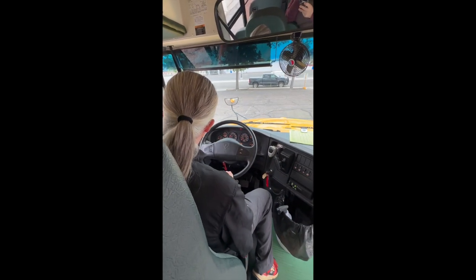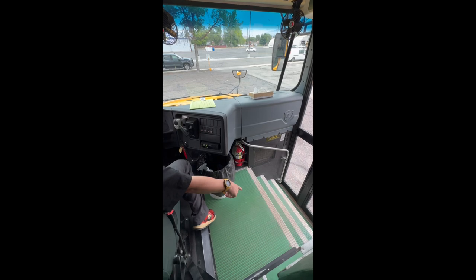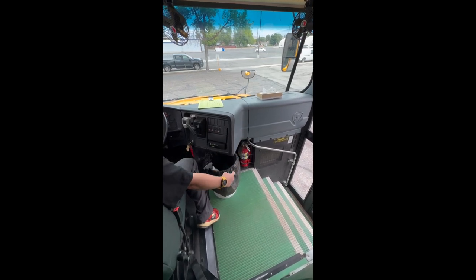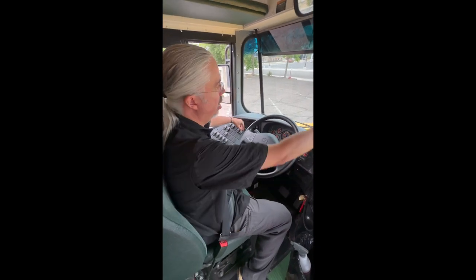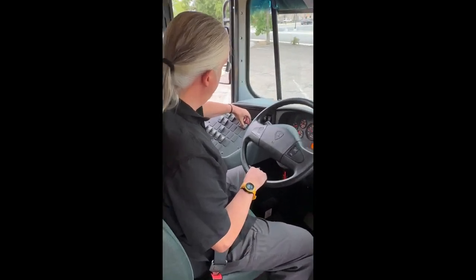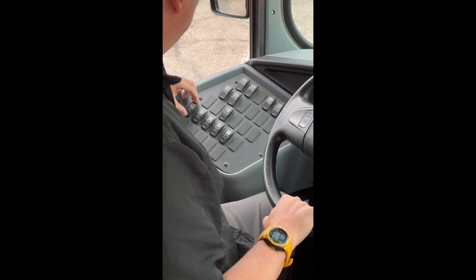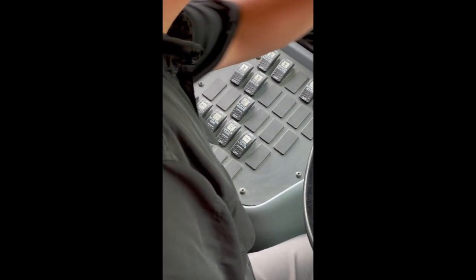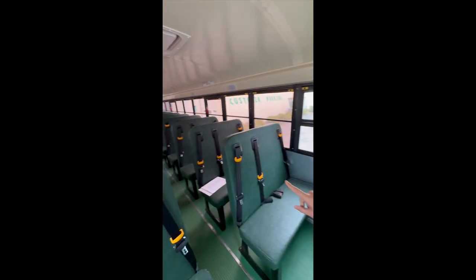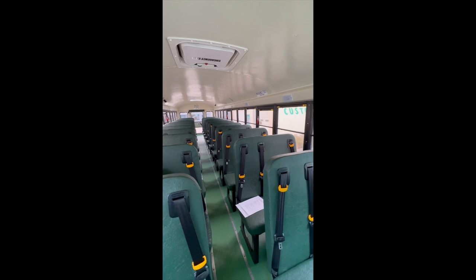Light goes off. I'm going to check our step well heater, making sure that it is operational for safety — that comes on. Our windshield defroster — I'm going to check to make sure that comes on with this switch over here. That comes on, we can hear it and feel it. Then over here, this bottom switch, I'm going to check our strobe light. We can see that the red indicator light is on. If we look back up through that last roof hatch exit, we can see that our strobe light is in fact strobing back there.